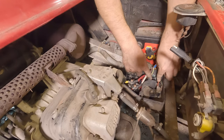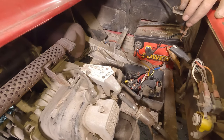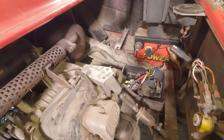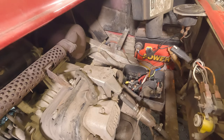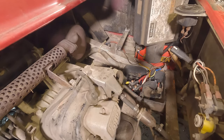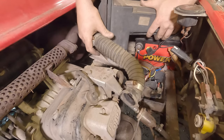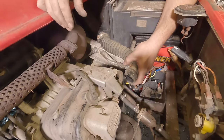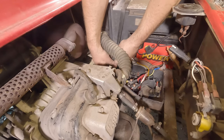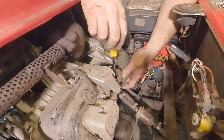Lock washer, nut — and one thing to keep in mind: these carts don't run very well without the air filter, so make sure you hook the air filter back up when you go to run it, otherwise it'll spit and sputter and cough. I'll leave the voltage regulator disconnected for a minute and check the air filter — pop it open. Perfect, as always — these things rarely ever go dirty because of the way the routing is on them. Put that back, strap the air box back on, tighten it so we don't have any air leaks.